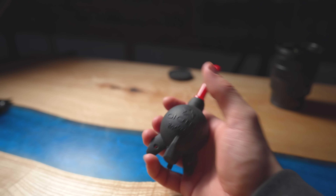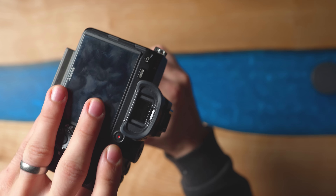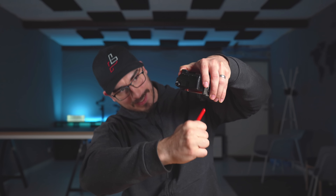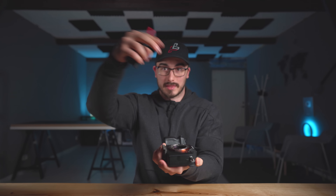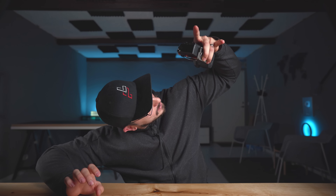Once you're done with that, grab your blower, then open up the sensor — the camera body cap — and do some high-pressure blows into the camera sensor. The reason I'm holding it upside down is because when you're blowing, the dust falls out. If you hold it the other way, the dust falls back in. So always hold it upside down when blowing dust from your sensor.